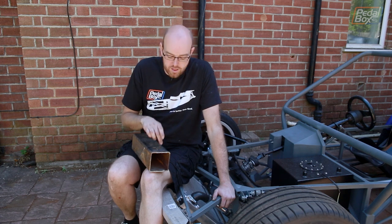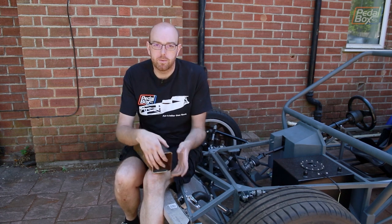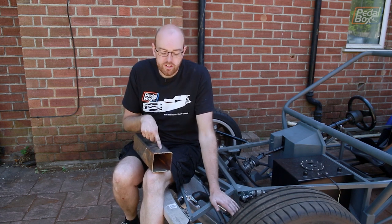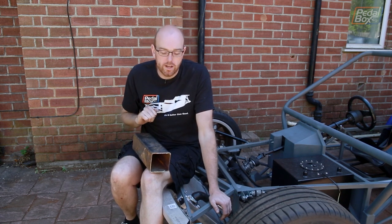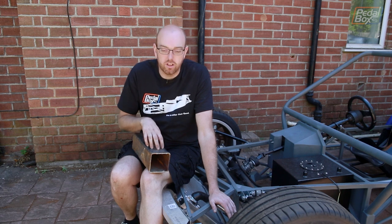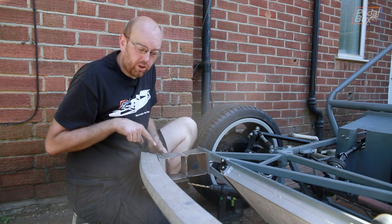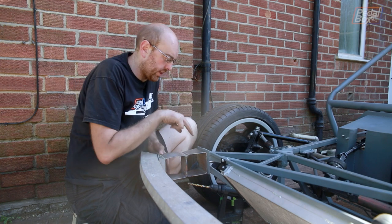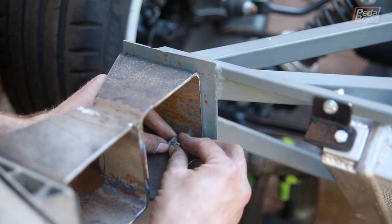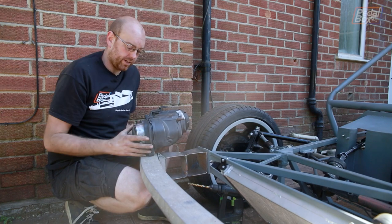Now, there's a good chance that if there is an impact at the front, these will actually break before these. Because they're just squares, they'll probably deform and just bend up and collapse, which is great, because these are much easier to make. So if this breaks before this, I'm happy — I'll call that a win. It'll also give us a nice solid mount, and we can do a few other bits and pieces to join onto this that we weren't sure how we were going to join on here. So I've welded these two pieces together and put the holes in to mount the crossbar on both sides so we can clamp it in place onto the car. This means we can line up the holes really accurately for what we need, not just what theoretically works.